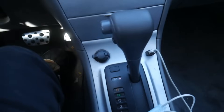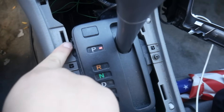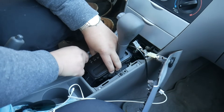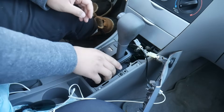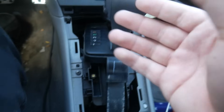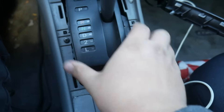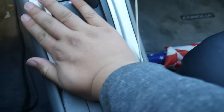The last light to discuss in this car is the automatic gear selector light. My XRS is manual so it doesn't have this, but my LE is automatic. Pop the surround out — there are four tabs. Take a screwdriver and pop at the tabs until they release. The bulb is in there, which I've already changed to LED. That's how you do the automatic gear selector — very easy. Pop the old one out, put the new one in, slip this back over, and press it back up and over.